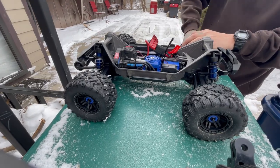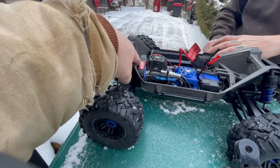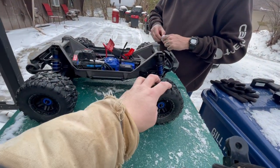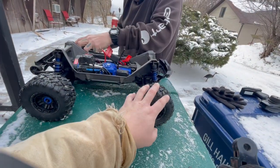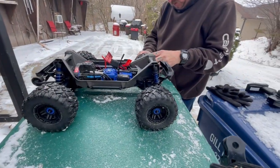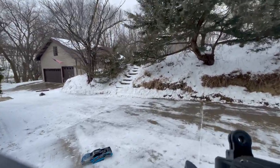He thinks his tires are too tight. My money's on inside this thing here. There's something not happy. We've isolated it. If you hold the tires solid and spin the other set, nothing sounds bad. You hold these solid, spin those, nothing sounds bad. You spin them so the center diff and all that connects, sad sounds. Sad sounds say so much.